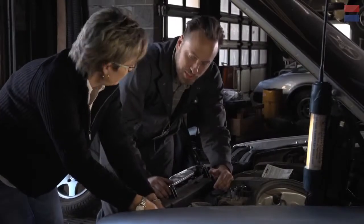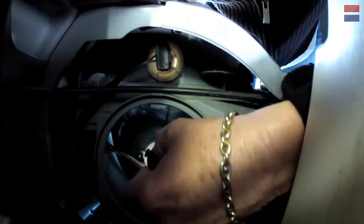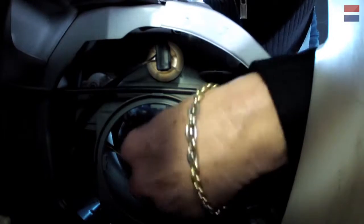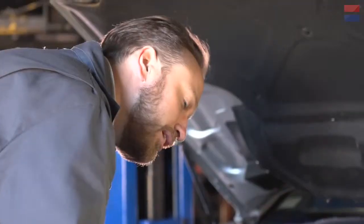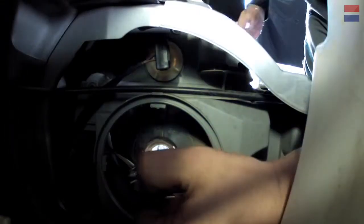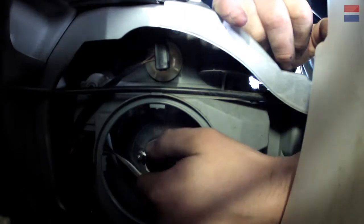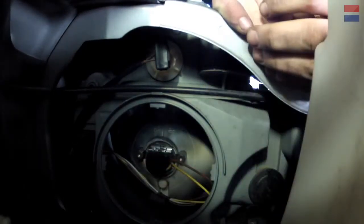Now what we're going to do is slide that back into place. It should slot in there, and you'll give it about a sixteenth of a turn and it'll lock in. The aiming is done with the housing of the bulb — it's just a matter of getting it keyed in correctly with the notches in there. If you look down in here, you've got these two wings right here, and these slide underneath these two screws. Put that in place, down in there, and give it a little twist until it locks. And then we're set.